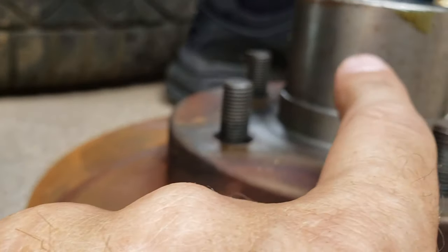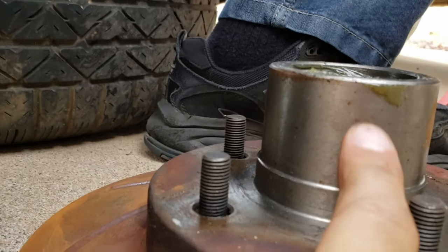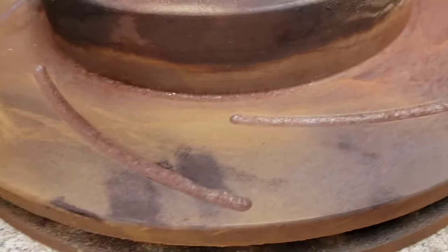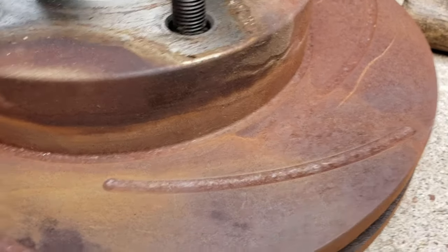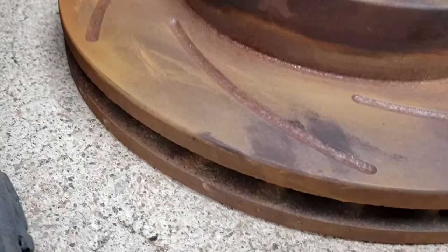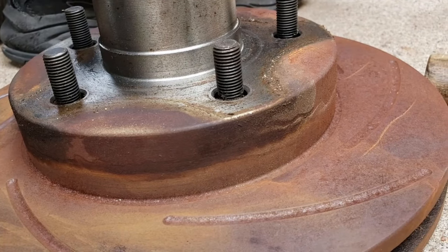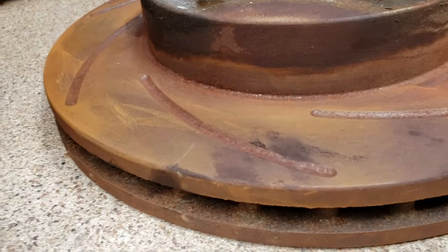You can see on the inner hub here, because it was protected by the rim, what the rotors are supposed to look like - that kind of stainless steel shiny-ish metal. But with the camera close enough you can see there is pitting in the rust, so yeah, they're definitely going to have to be turned. They're not going to be able to clean out the air grooves, which kind of sucks, but we can try to wire brush and steel wool as much as possible. The air grooves help air and brake dust escape and not build up - it's a lightweight design so they're not designed to last very long anyway.